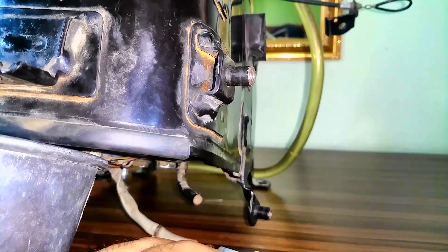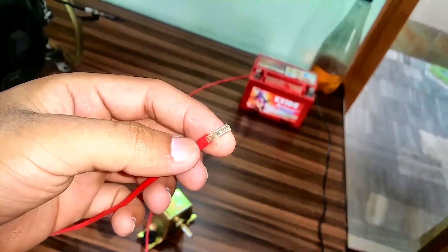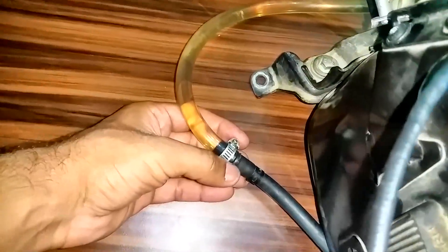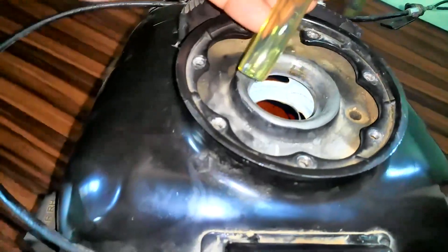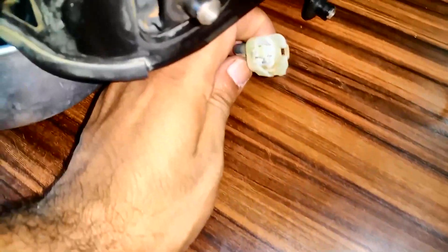For that you're going to need a 12-volt battery. I've already got the wires, and you'll want to insulate these to make sure there are no short circuits — we don't want any sparks. On the other end, this black pipe goes right into your fuel injector. What I've done is used a piece of plastic, extended it, and put a transparent tube that goes right into the fuel tank. We're going to apply 12-volt potential across these points and the fuel pump is going to run.